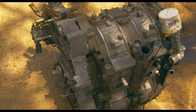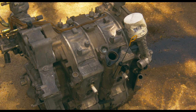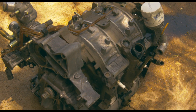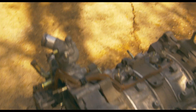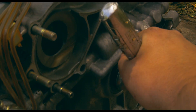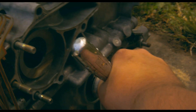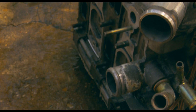As for how alive this engine was — the front rotor died. This is not a reman engine either, which is surprising. The rear rotor was still good, but the front one was dying, flooding. He tried replacing the alternator and starters to see if he could get it to keep starting, but it wouldn't hot-start, kept flooding, and eventually started shooting fire out the exhaust. We can also confirm that with a trusty 19-millimeter.